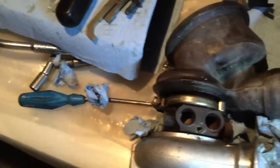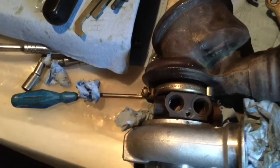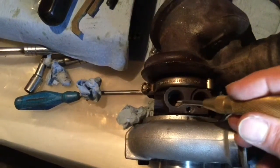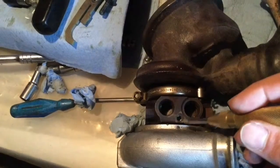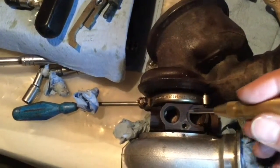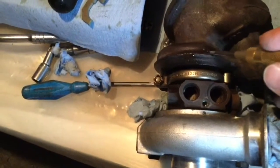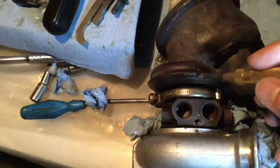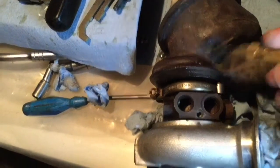So you have to do it several times, because sometimes it's not punching hard enough. So I use this screw hole here to locate the punch mark in between the two coolant ports, and also on that one here. This one was not aligned. This one here, the lowest one, is the right one.